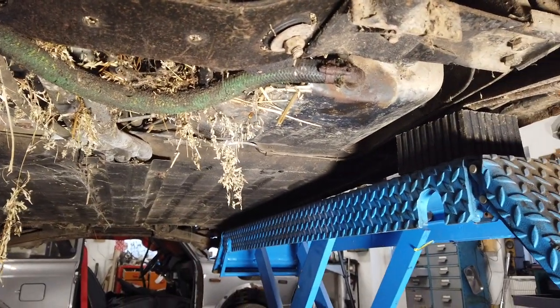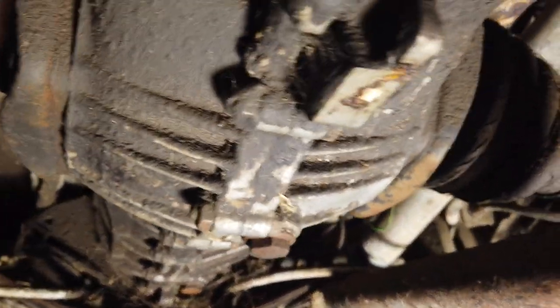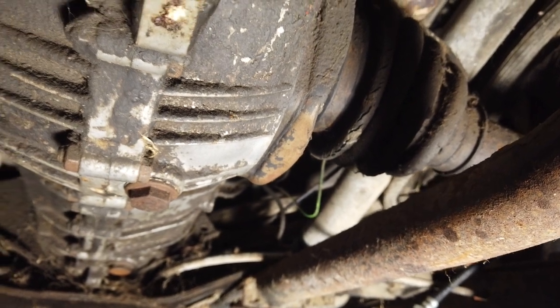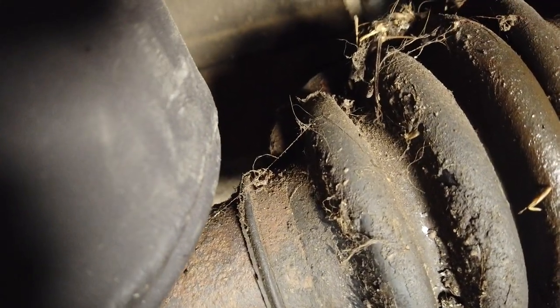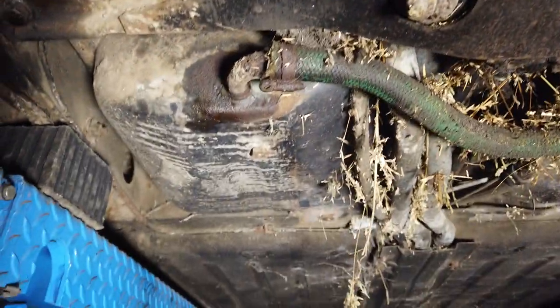What I'm going to do now is replace that piece of rubber and get the fuel tank situation back under control. I just noticed that this gaiter is actually perished as well — I would most likely need a new one of those. That could be an MOT fail. I'm also having a bit of a coolant leak up there — I just noticed it. What's that coming from? Is that the pipe itself?